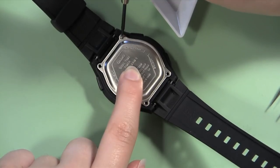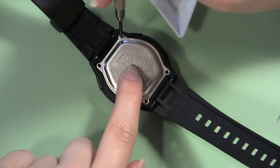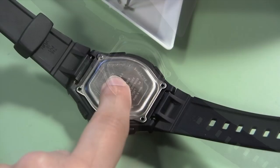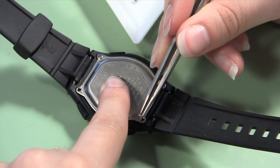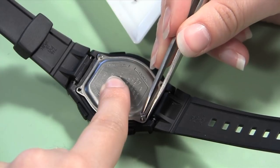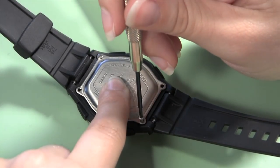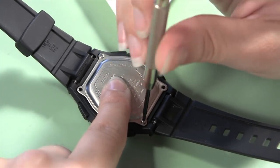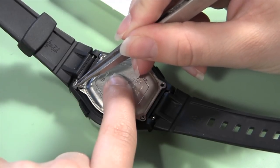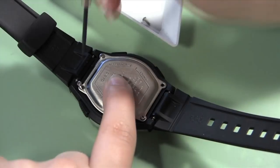When the screw is in place, take your screwdriver and begin to thread it back into place, turning the screw clockwise. Continue tightening until the screw is mostly screwed in. Take the next screw and place it diagonally in the case back from the first screw you replaced. By placing the screws in this manner, you ensure that the back sits on the case perfectly. Tighten the second screw most of the way into place before moving on to the third screw. Place the last two screws in the remaining slots with your tweezers, tightening them most of the way into place with your screwdriver.